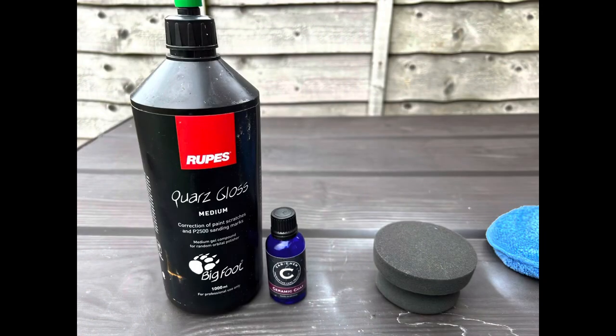I left them to dry, and in the meantime I cut all my seals out for the back. This works, by the way — if anybody wants to do this, it works. I'm actually lending these stencils out to a mate who's going to do his as well. Once you've allowed your lacquer to dry, you've got your nice edging around the edge and you've removed all the mask. You'll feel then that you've got a slight sort of lip where you've smoked and lacquered. That may be an issue down the line with it peeling off, so what I then did was get some medium compound, by hand, and just gave them a nice smooth — not going too hard where you've lacquered, but just to smooth the edges down for longevity.